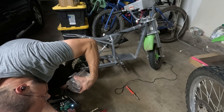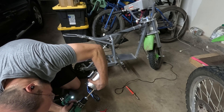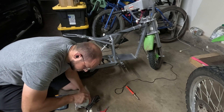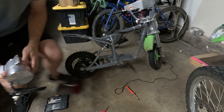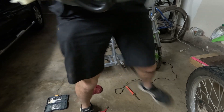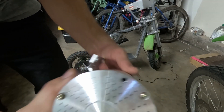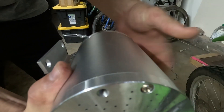It's gonna stick out the other side — it's a fairly long screw, so the screw's gonna be sticking out a quarter inch out the other side. That means for one of the mounting points, you actually need to shave off one of those screws. You're gonna have to cut it, or I just ground it down with my grinder. However you're gonna do it, you're gonna have to grind down one of those screws because of the mounting points.